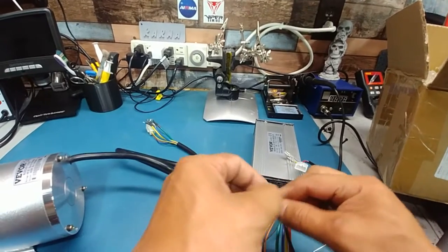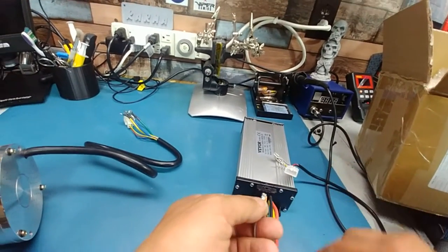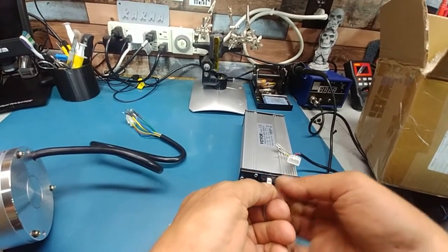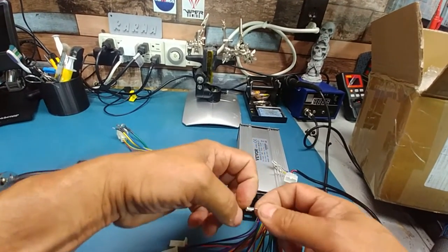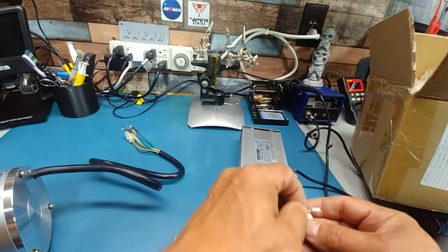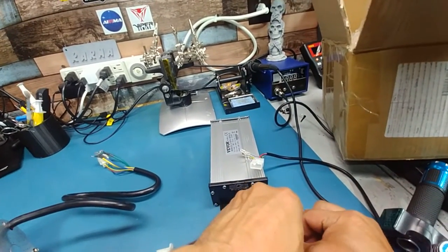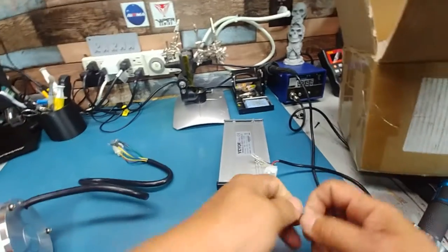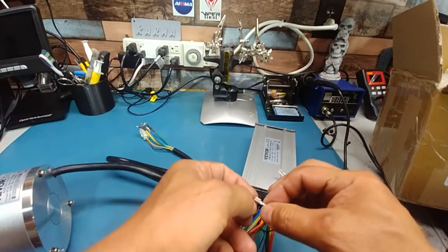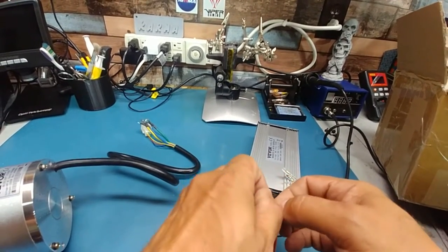There you go. Now before you put it back, the little finger that I was telling you about is on the back of the connector. It's just a little shard of metal. You're going to bend that back out, so when you push it in, it locks in. Just like that, as you can see. It's like a one-way shard, like bamboo. And when you stick it back in there, it'll click and it'll lock. It won't keep falling out. This is much easier than cutting wires. And there you go. You'll learn something new every day. Doing this for years, you'll learn to stop cutting wires.